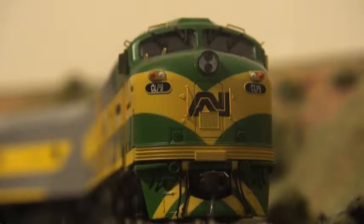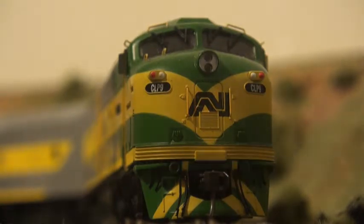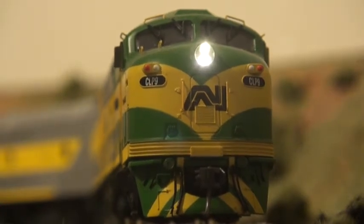The black spacer that you've glued in there is going to need to fit between the two LEDs. If it's a little bit too long, you can cut a little bit off when you try and reinstall it. Reassemble your locomotive and program it up with a LokSound programmer. I programmed auxiliary one — the green wire — as a ditch light, and auxiliary two — the purple wire — as a ditch light reverse phase, so when they operate they flash. I programmed them into function button number five to get them to flash alternately, and also hooked them up to the horn so when I blew the horn they would flash for about six seconds.